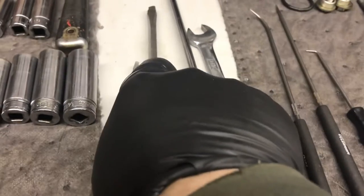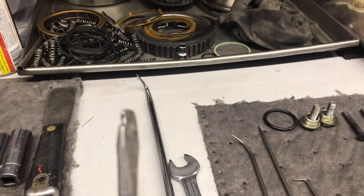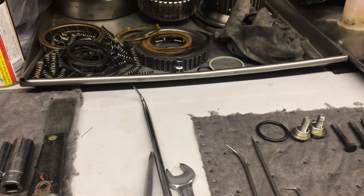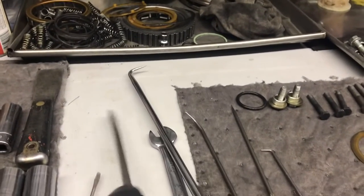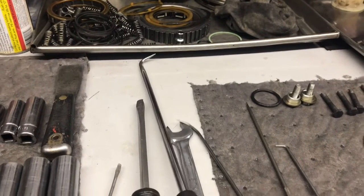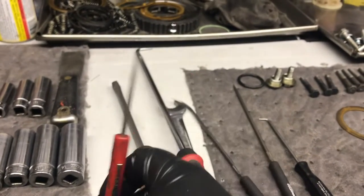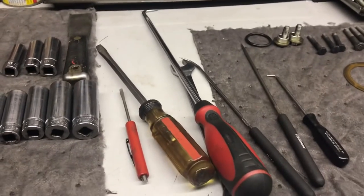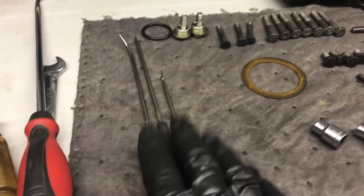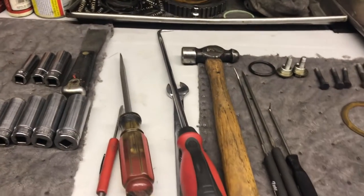A scraper, a screwdriver to pop snap rings out — I ground a groove in mine as a teenager and have just about worn it out after thousands of snap rings. I like to augment it with a big pick: pop the snap ring away from the case, get under it, and pop the snap rings right out. For the drums themselves, an old freebie pocket screwdriver with a magnet works great for pulling check balls out and will pop drum snap rings and the sprag snap ring with ease. The more picks you have, the easier it gets. And a small ball-peen hammer that I use to beat on my screwdriver to remove the front and rear seal.